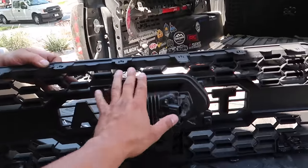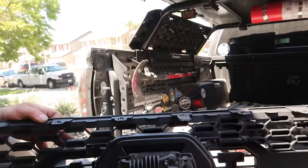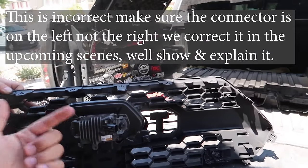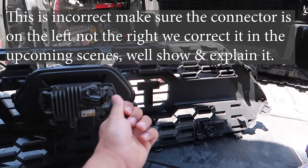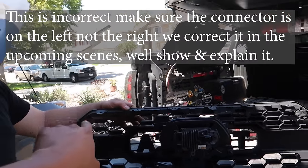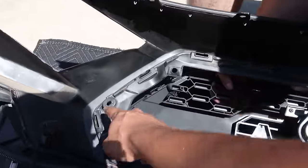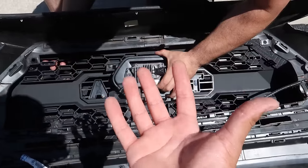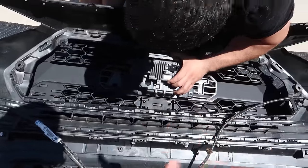Now that you've mounted on the bracket that we cut out — this bottom section is the one that was cut out, take note on that. Also take note: the sensor is pointing to the right side, which is going to be the passenger side when installed, and it's going to be connected from this side. Take note so you put this in correctly. Now all we have to do is go to the bumper, put it on. What he's doing basically is aligning all the clips along the way and the grille should just insert on its own — it's going to clip in super easy. Just do the reverse steps from when you took it off and you'll be good to go.